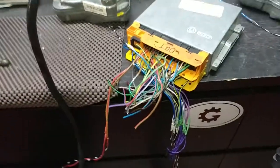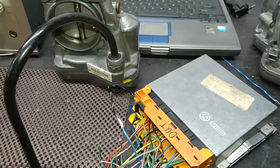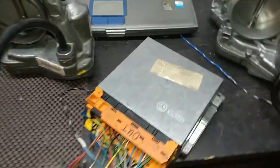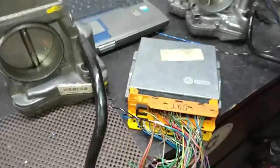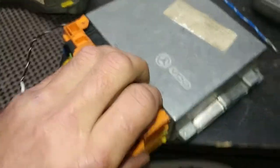We're going to plug the throttle back into the original e-gas module that was sent to me — this bench also handles V8s as well as V12s. Double-checking again one more time: power on — no good. So the next thing I'm going to do is plug in another e-gas just to confirm that all the wiring is good.